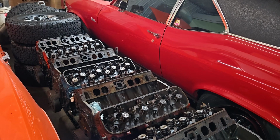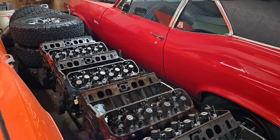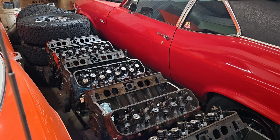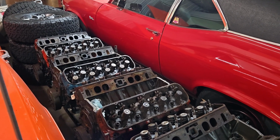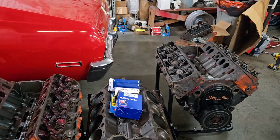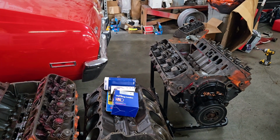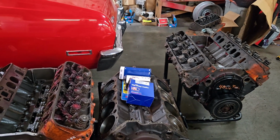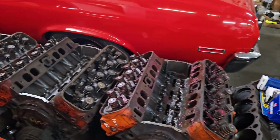445 castings. There's a couple of these that are 2 bolts, but they're standard bore. And for storage purposes, the 781s and 049s that I'm going to use on these motors, I have put a couple bolts in them and I'm holding them on these motors. They are packages or core units that will make a 600 horsepower 454 big block Chevy sometime in the future.